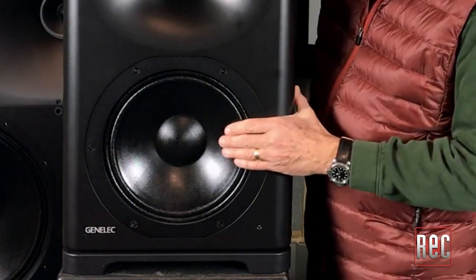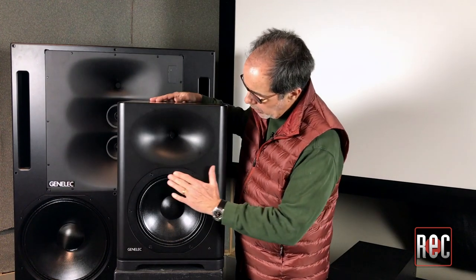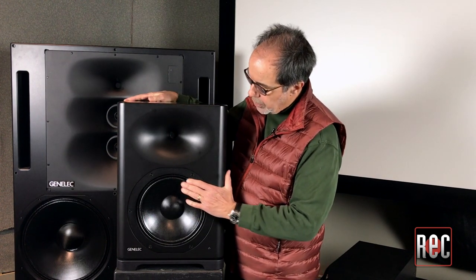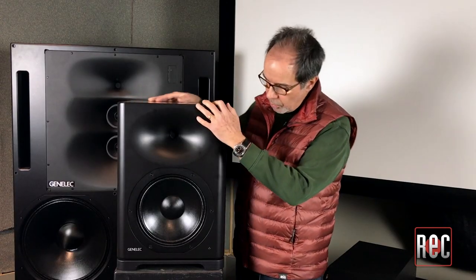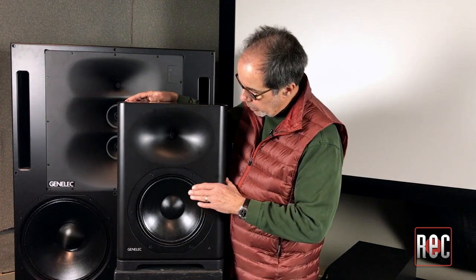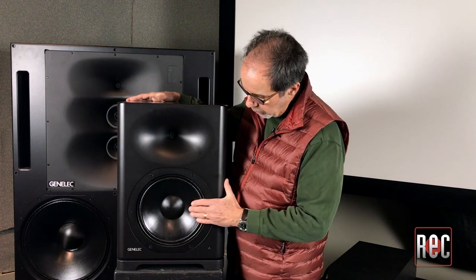Can we talk about the bass driver? The bass driver is borrowed from our Master Series products that we've been using for probably the last 10 years or so. It's the exact same size as what we use in the 1038 AC, the center channel product. But we've had other design changes in order for it to work more properly as a two-way instead of a three-way. What is the bass driver made out of? It's a coated paper. The cones and surrounds themselves are very robust and durable. They're incredibly robust — built to be quite indestructible — and they certainly are what I would call very low distortion drivers.